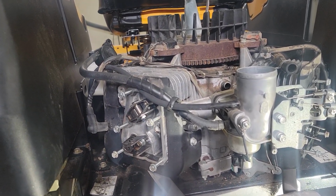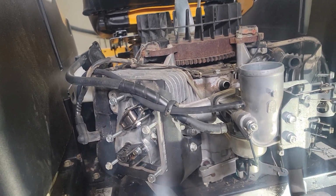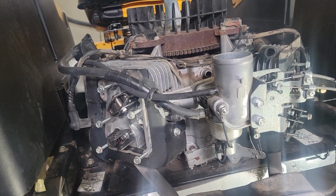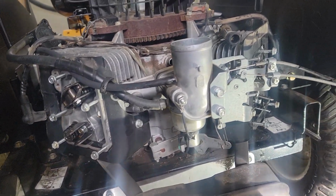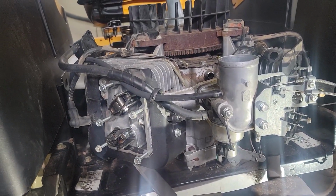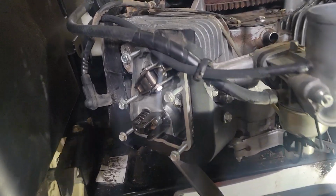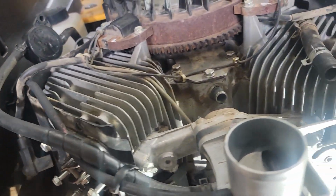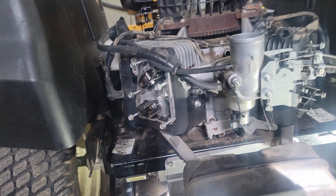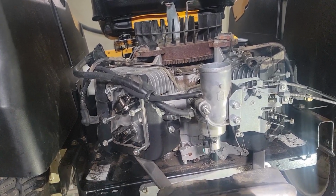They were 6 thousandths. Usually it's a little larger for the exhaust and the intake, but I think it's both 6. But I'll look that up. And the gaskets are simple. The wiring and the linkages we just have to be careful with. But if I put all the bolts in a baggie and label them, it's going to be so quick on assembly. I just label the bag: valve cover bolts, head bolts, carb bolts, whatever, so that when I'm getting back in here, in between time, I've got many other projects going on, I don't start losing parts and taking a long time.